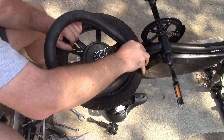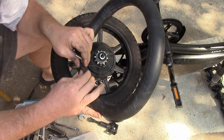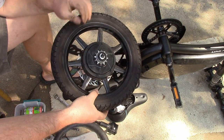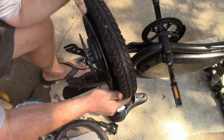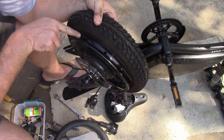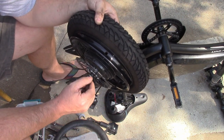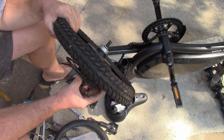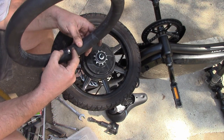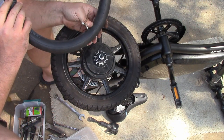There it is. The tire just sort of blew out internally. That's the only damage I can see. What's strange is this rim is extremely smooth on the inside — it doesn't even have a need for a little inner liner to protect from spokes, it's just a smooth rim. I don't really understand how it could inflate in such a way it would have a bubble right there and explode. It looks like there's enough space to patch it, but there are other little defects where it looks like it might want to burst at the seam, so I might just go for a new tube.